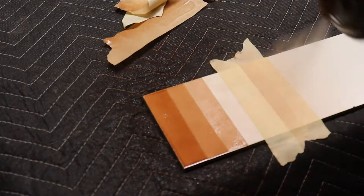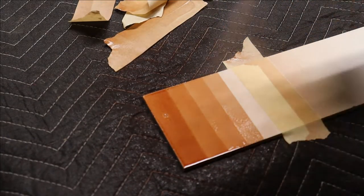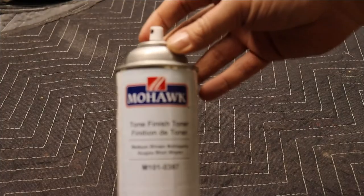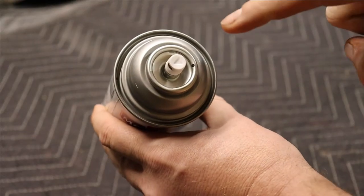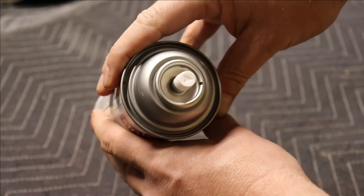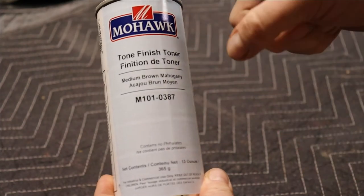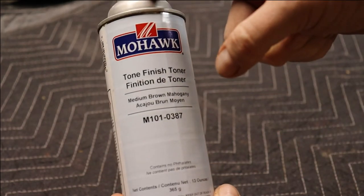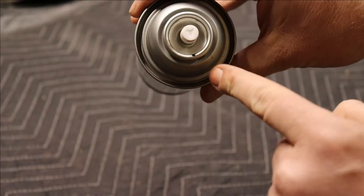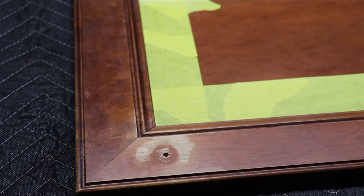There's a real easy way to do it off the piece — I usually recommend a piece of paper or a white melamine board, something where you can get a true color of the tone that the toner is. Now let's talk about the genius of the Mohawk toner: at the very top of your aerosol can you'll find a black dot. That black dot represents the direction that the nozzle should be spraying. If your nozzle is not arrowed that direction, turn it. Inside every aerosol can there is a straw that comes down to the very bottom in a corner — if we were to draw the straw it would end where my thumb is. If you turn the can toward my thumb and follow back up, that's where the black dot is. This shows you which direction to constantly use the can so you have a consistent finish the whole time.